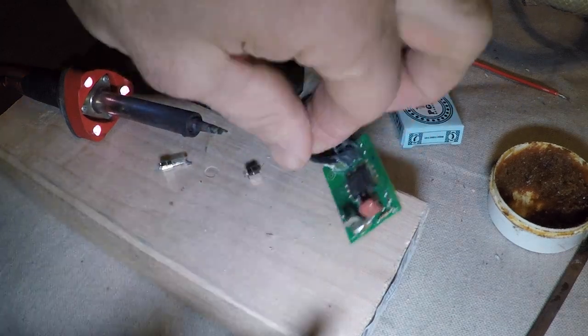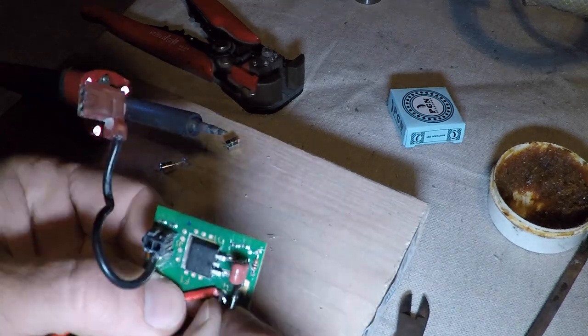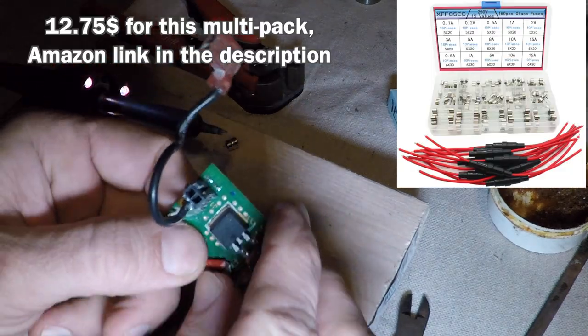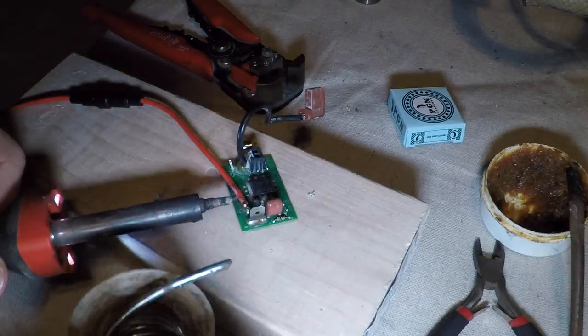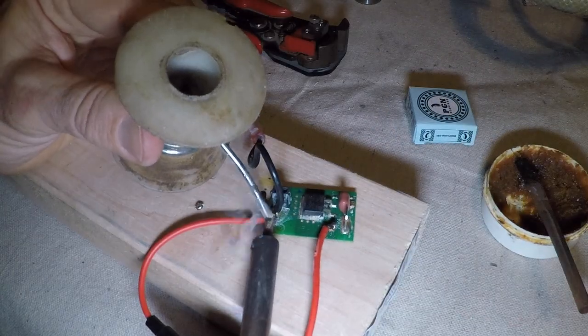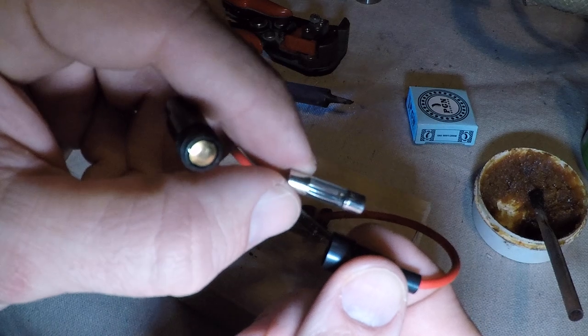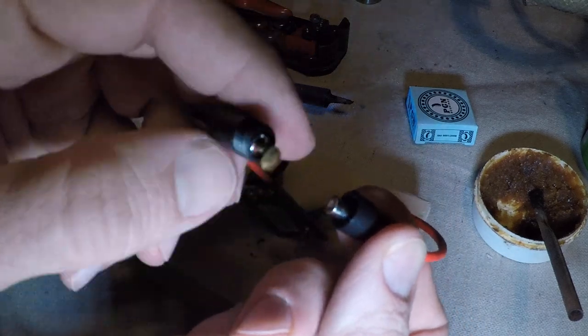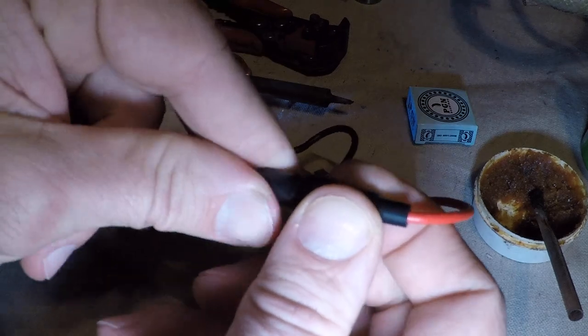The inline fuse I'm using looks identical to the old glass fuses that came in automobiles, but there is a difference between the AC voltage one I've got here and the DC voltage one that came in cars — they're not interchangeable. So if you are going to be doing this, make sure that you use the right one. I'll put a link for these in the description below. This is a 250-volt 10-amp fuse, same one that was in here before. The only difference is now it's replaceable.